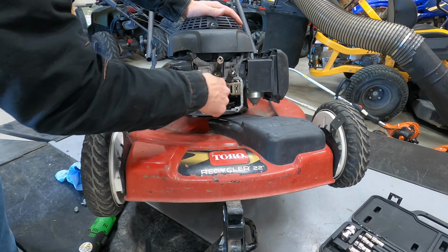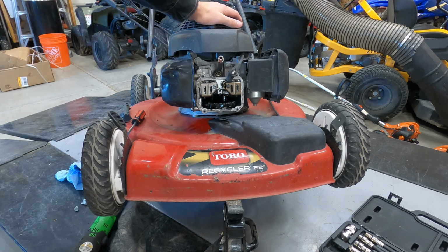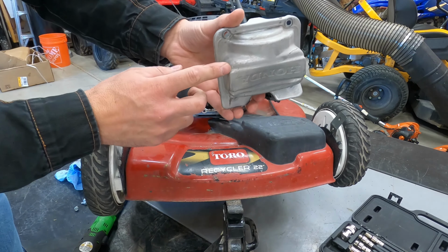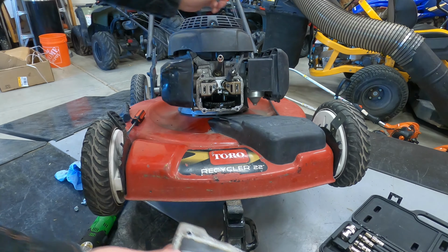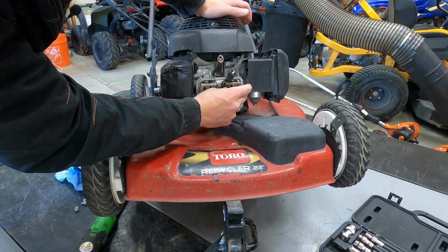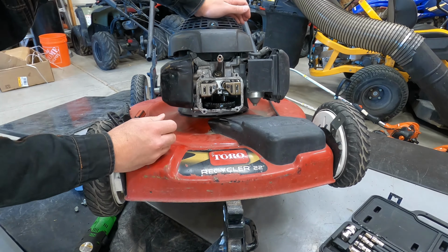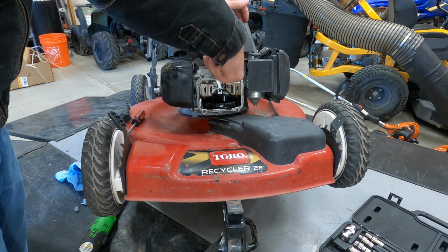You know, the valves are moving freely. You just want to make sure the valves didn't get bent as well. If that got hit at the side or something, and that valve cover, depending on the angle, if one of these pieces had gotten bent in sideways and bent one of these tappets or something. Just want to look everything over, make sure nothing's cracked or damaged. But that should be the issue.